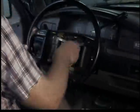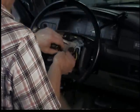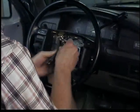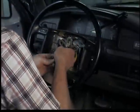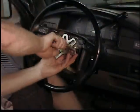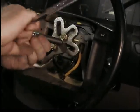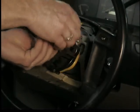I'm going to loosen the bolt up and disconnect the wiring so I can get a steering wheel puller on there and pull it off. The steering wheel puller just bolts to the steering wheel and has a center bolt that pushes on the bolt in the shaft. Leave the bolt in the shaft so you don't tear the shaft up. Just tighten the center bolt and it'll pull the wheel back against the bolt. Then take the puller off, take the bolt out, and you'll be able to pull the wheel all the way off.